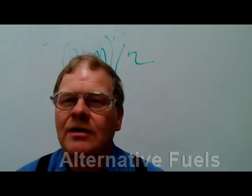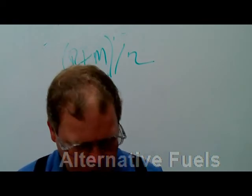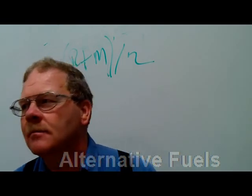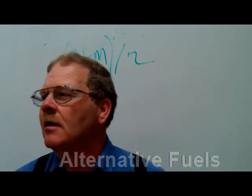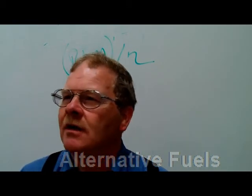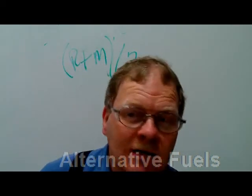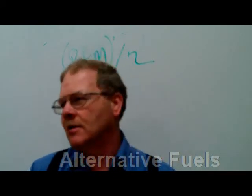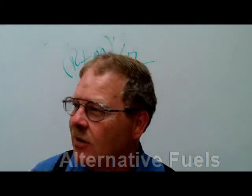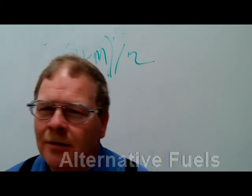Yeah. Whenever we measure fuel injector fuel delivery, the only electronic fuel injectors that we've got, how are they measured? Pounds per hour. If you're Japanese, CCs. Like on the old Fords, the gray fuel injectors the Crown Vics had on them were 14 pound per hour injectors. The orange ones, like the Mustangs had, were 19 pound per hour injectors. When you're loading fuel in an aircraft, you measure it by the pound, you don't measure it by the gallon. You know why? Because nobody's paying for it by the gallon. They're paying for it by the pound.